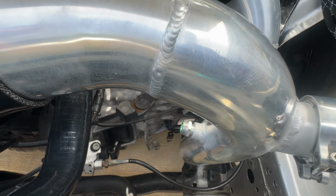All right, so moving down, you can see here how it looks. We have made it into a 4-piece intercooler. One of the things you need to remove is this whole strut piece. The reason we've done this is that it was a very difficult task to get that to fit with the OEM piece there. Also, you're going to have to trim this here, as you can see. And there's also slight trimming here inside. That is required.